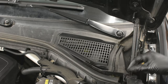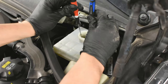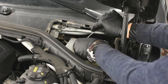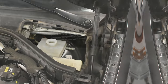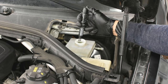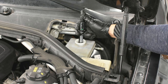Remove the plastic cover. Remove the filter insert using pliers, screwdrivers, and all the bad words you know. Now you can use your brake fluid quality indicator tool to see whether the fluid is still good or not. Stick it into the reservoir. Mine is good — the indicator shows green color, but I will replace the fluid anyway as per the 2-year schedule.